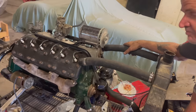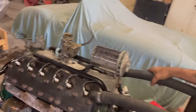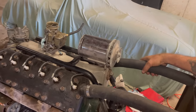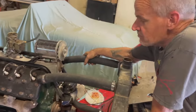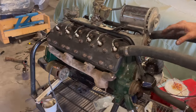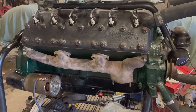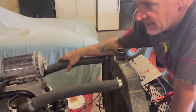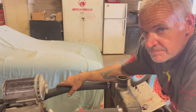All right, now what do you need to bench fire an engine? What's involved? Oh, just loosening it up, if it's an old one like this. This has been sitting for an unknown amount of time. Yeah, WD-40 and transmission fluid in the cylinder. Wash out the pan, of course, and let it sit for a while, break it loose, make sure we didn't break a ring. Okay, so you let it sit, did you hand crank it? Yes, you hand crank it with all that lubrication in there, make sure it's moving freely.